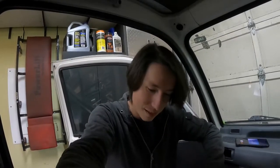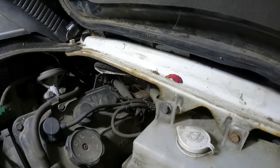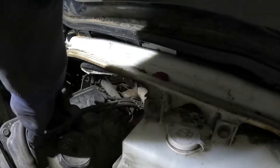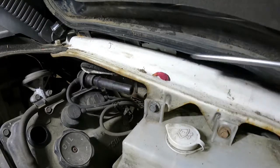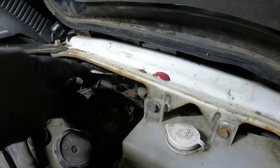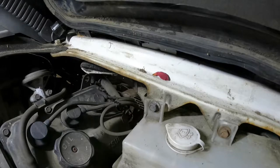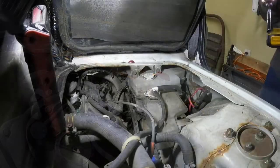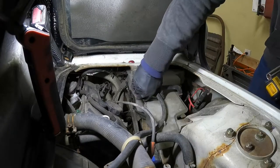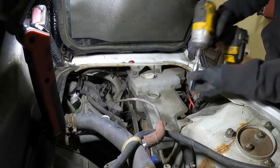Well, that was wishful thinking, but this is pretty much what I expected. We're going to check for spark again. At least it's inside in the garage now and I can spend a little more time on it. We still got no spark. I might have to commandeer some help to check the coil. Next thing I'm going to try is to access the coil and just see if we've got power there, then keep working our way back until we find where the loss of power is.